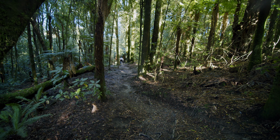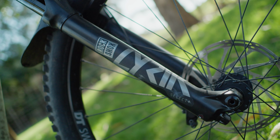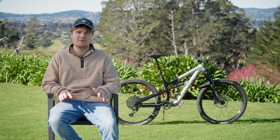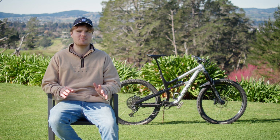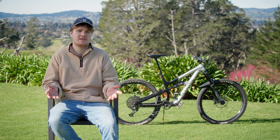I'm going to cut the negativity for a second and talk about something really positive. In the review I talked about the fork being a solid option, but not anything amazing. Since then, I've played around with dropping the pressure and increasing the low speed compression, and it feels so much better, so much more supportive and smoother off the top. I actually think it's a really good fork now, and I'm sure there are better options out there, but for now I'm just pretty happy ignoring them.